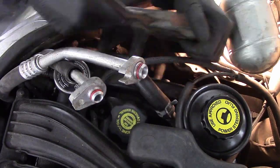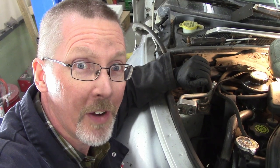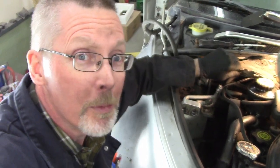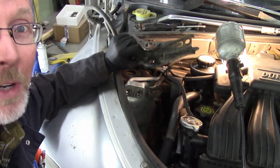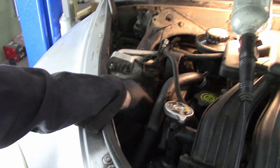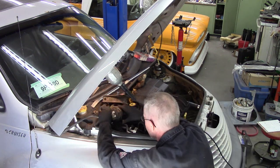Still arguing with trying to put that plate back in — I'm not even sure how I got it out at this point. Unless you want to find some creative combinations of colorful euphemisms, you're going to want to remove this bracket which attaches to the front strut tower. There is a bolt in through here and a nut in through there, and presumably that frees up enough room to get everything apart. I didn't do it that way. There was some language. With that bracket removed, things went better — not awesome, but better. A little bit more accessible.